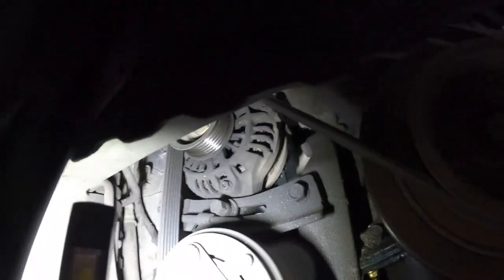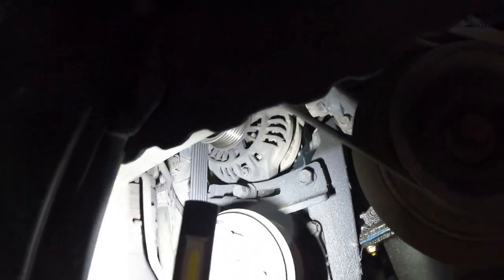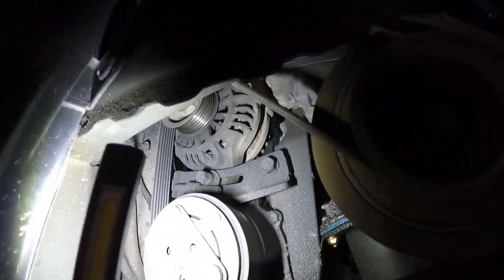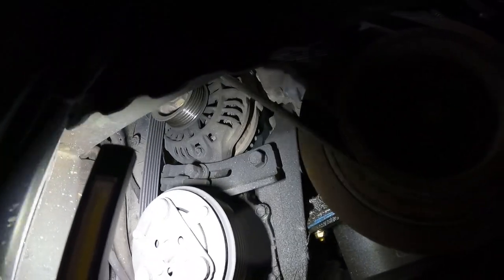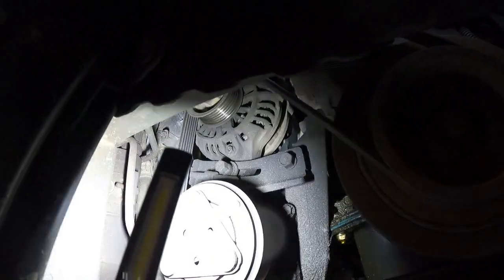And the alternator belt — let's get from the bottom so I can see the alternator. On the adjustment bracket there's one bolt right there that holds the alternator, and there's one on top where it hinges from. Loosen both of those up, and then there's a wing bolt on the front — same concept. Loosen that up to get the belt off the alternator. I'm going to pull these belts real quick and check back with you.